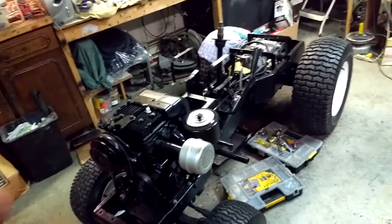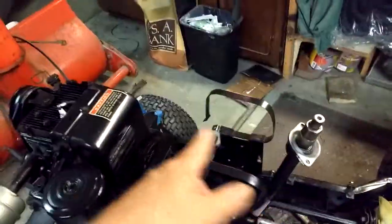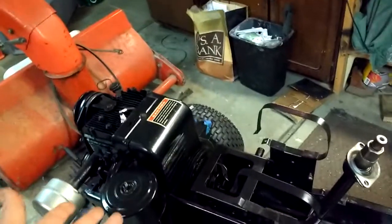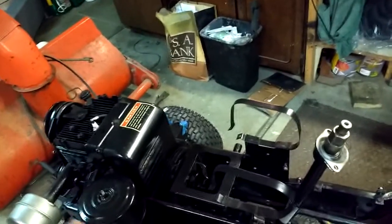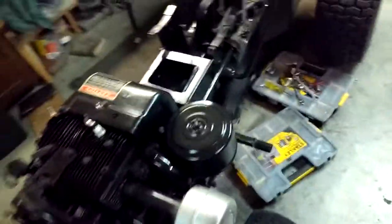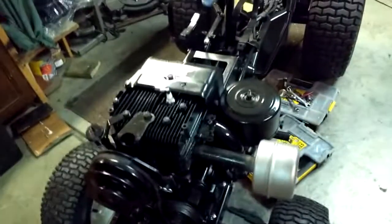Once the body parts are painted I can put the shroud back on, get the wiring hooked up, put the gas tank in, and fire it up. It's going to need work — I cleaned and bench synced the carb, which basically means I went with the default settings on the jets. Maybe it'll start and run. If not I'll have to play with it. This screw is set to about two out — I found the default setting — and same with the screw under the back.